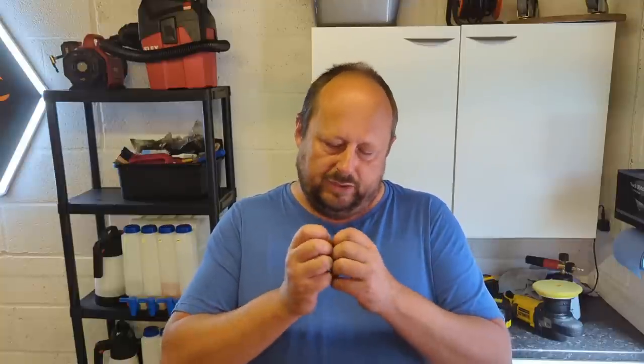I hope you found that interesting. What do you think of the Japanese wash method? It's not too dissimilar to what we're already doing, but it just avoids having to carry around two buckets, which can be a little bit of a pain. The main strength is the way that you get loads of solution into the foam — it really aerates and gives you a nice thick, slidey lubrication layer. The sponge is better than other wash media at putting air into the solution to give you that foam. Konichiwa — thank you very much. The whole range of products shown in this video will be linked in the description. They're available from the Soft 99 store and other distribution partners. Thanks very much, take care and stay tuned.